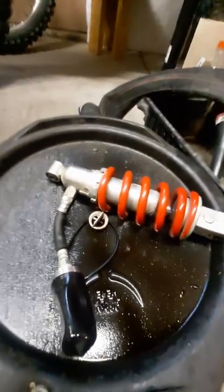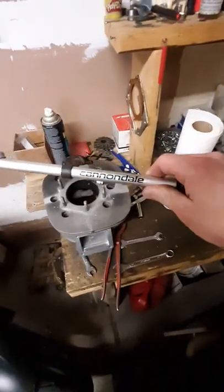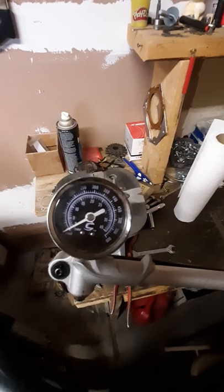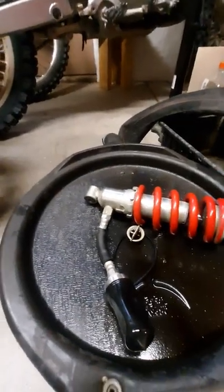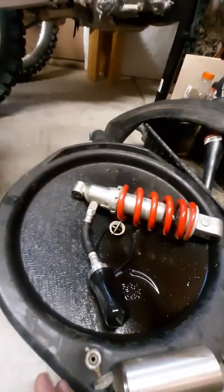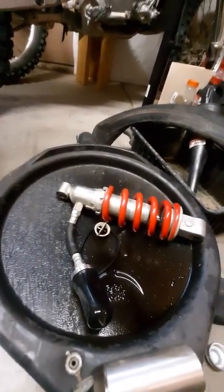It's working great - holding over 100 psi with a bike pump. Everybody wants to tell you you need nitrogen, but I've done them for years with the KX's. Get one of these - it's a Cannondale brand hand pump - that little son of a bitch is all you need. Just fill them with air, preferably low humidity. If you live somewhere like Louisiana it might contain a little more moisture, but a lot of guys are doing the same thing and nobody seems to have an issue. Air is already about 79% nitrogen.